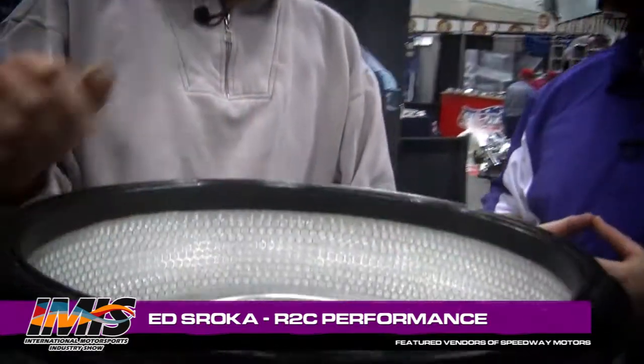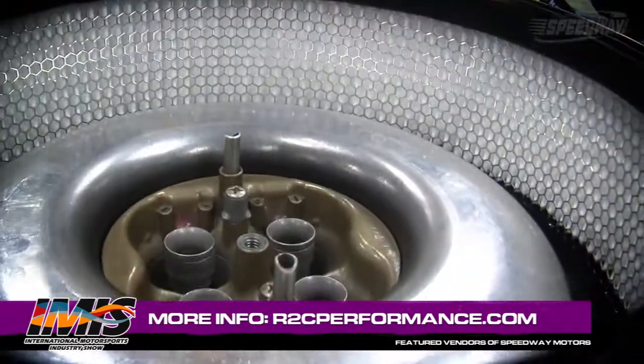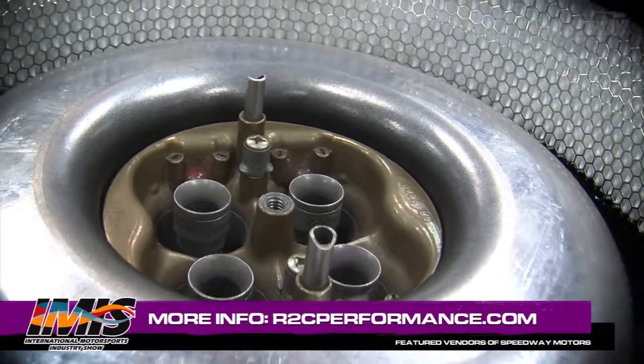We have some new technology being introduced very shortly. We've done 150 dyno pulls in the last few weeks, and we're continuing to improve the profile we built using this offset filter, improving the signal to the boosters in the carburetor, making all that hard work and carburetor purchase as effective as possible. By creating flow directors and having them interchangeable with our new base, it's going to be a really effective tool for guys to tune at the track, on the dyno, and give them opportunities never seen before.